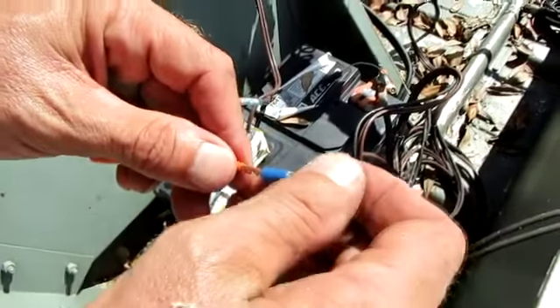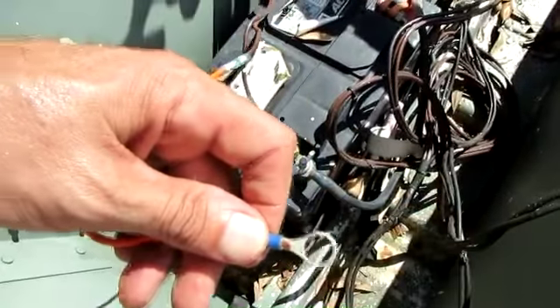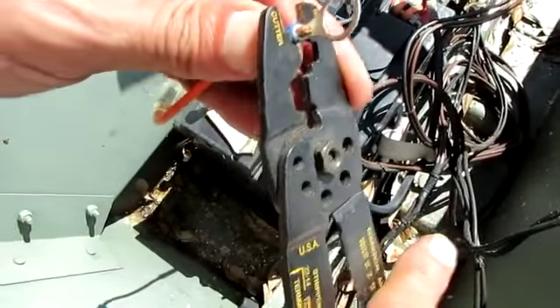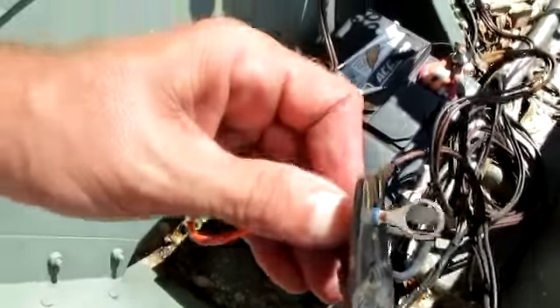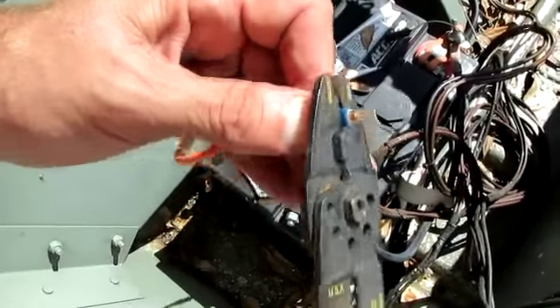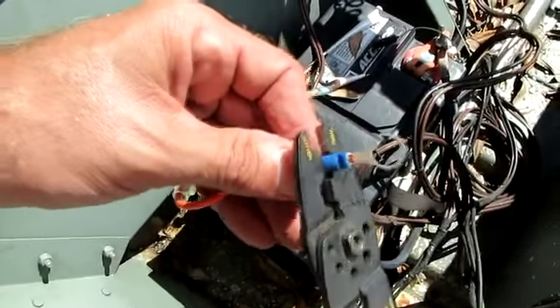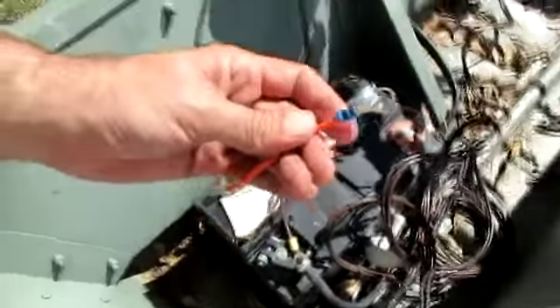Here's my terminal — make sure you get a terminal that's the right size for your connector stud. This one fits perfectly. Same thing, you want to see wire sticking out the end. Give it a good hard squeeze where you're squeezing the entire wire, and just a nice snug on the back end of it.